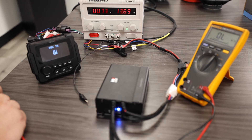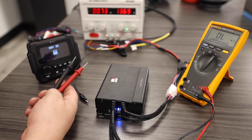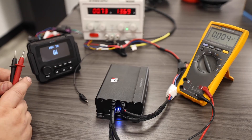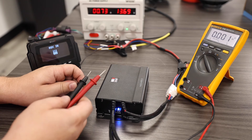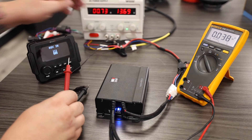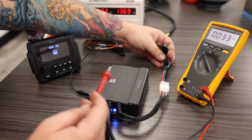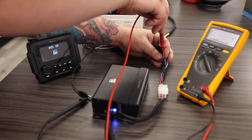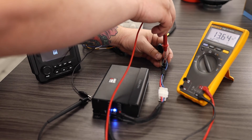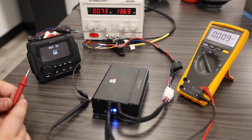Some easy ways to test the voltage at our amplifier and see what our amplifier is seeing is going to be utilizing our digital multimeter. For these tests we're going to be wanting to set it to the DC voltage setting. We're going to connect my ground lead to my ground wire and my ground terminal of my battery, then I'm going to use my positive probe and come to my fuse and test both sides of my fuse. As we can see I'm getting 13.6 volts on either side of my fuse, which would indicate that my fuse is in good working order.